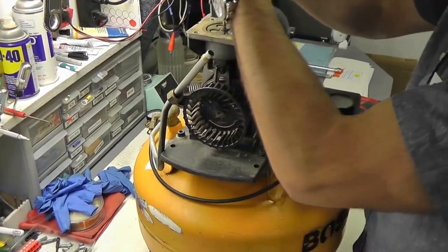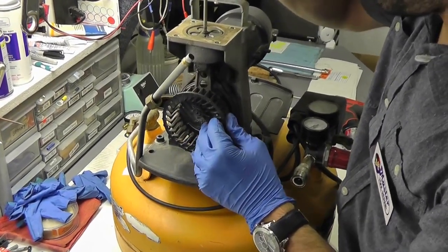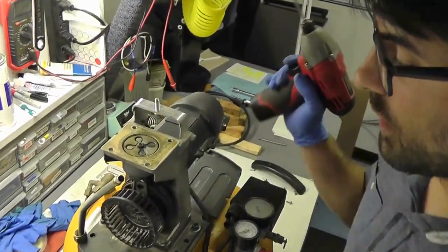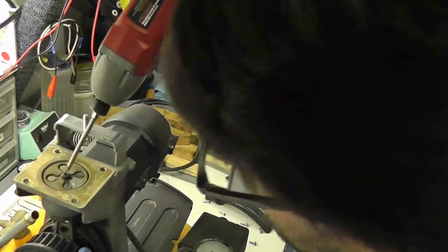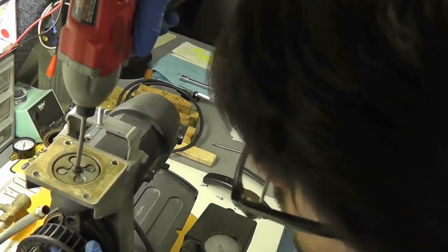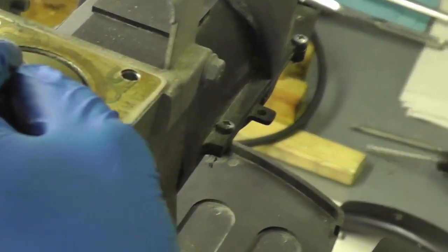This may be very difficult to remove and you might need a driver — by hand it's pretty difficult. So I'll use a little quarter-inch cordless impact gun. The impacting action should loosen it. The piston screw is in there really well; a lot of times there's thread sealant on the thread. The impact did the trick.